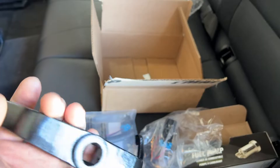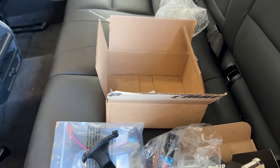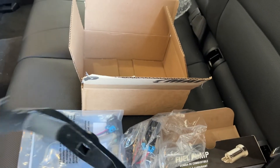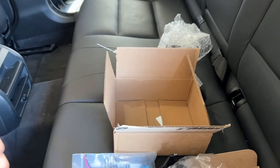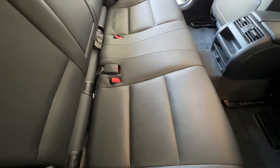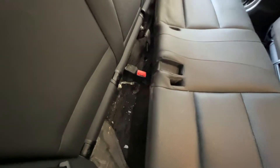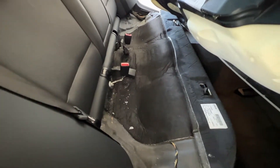Most people I saw don't use the special tool — they use a hammer and bang it around for like five minutes. I tried it before, I don't like it. This tool was about 20 bucks — well spent, instead of dinging around for 10 minutes when you can just unscrew it. So first of course the seat has to come out. You just scrub down here where the carpet starts, grab the edge and give it a pull — same on the other side. Now it's loosened and you can wiggle it out carefully. Let me take it out and clean up a little bit.